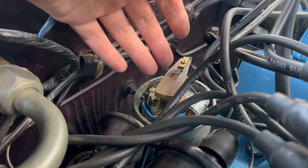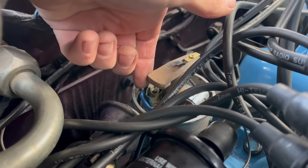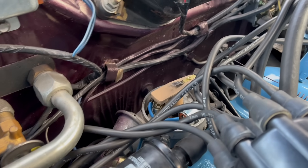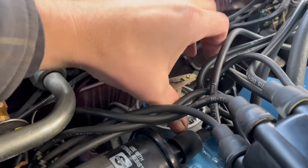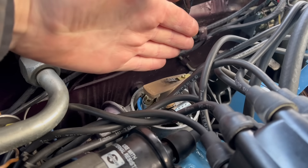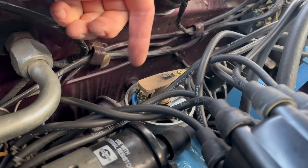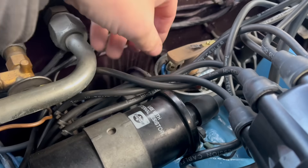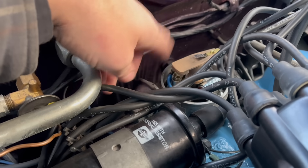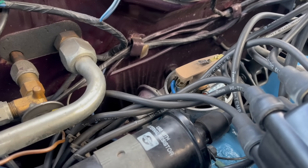Now, if you didn't see that road trip video, this is what I pointed out then: there's no spring action. Now, of course on the Mopar, the gear is in a separate shaft, and you don't have to get this pointed exactly correctly when you reinstall the distributor. You can only put it in right or wrong. So make sure you note which way it's pointing before you pull it out. You can put the body in many different positions, so I always eyeball where the vacuum pod is pointing and try to get it back that way when I'm done.